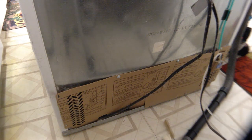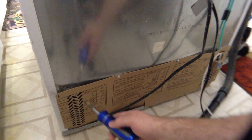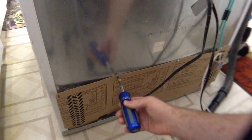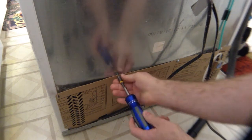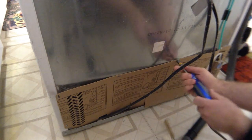In this video I'm going to show you how you can clean the coils on your modern refrigerator. There's a cardboard exit panel here — it just helps control the airflow for the venting. All you need is a little nut driver to remove it. You'll want to put the panel back on when you're done cleaning the coils.